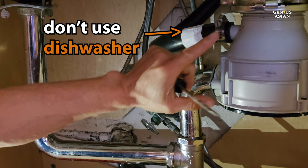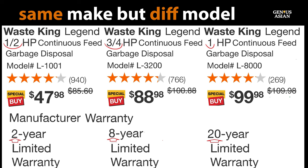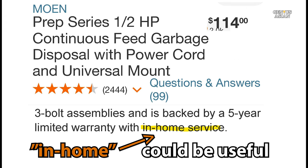When choosing a new disposal, you'll see there is quite a price range. Two things in particular to look at are the horsepower — how strong a disposal do you want? There is a range from one-half up to one horsepower with the same manufacturer. Also look at the warranty length, because that is another point of variation. You might think the longer warranty is better since it's not that much more money. However, if your disposal fails within 20 years and you want to use that warranty, it will take time to contact the company and receive a new one, leaving your sink out of commission. With a two-year warranty, you'd likely just go to the store and have a new one within a couple of days.